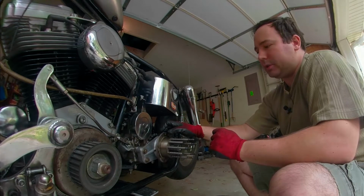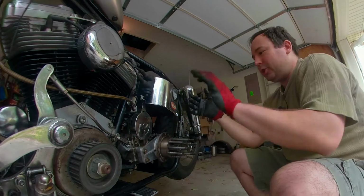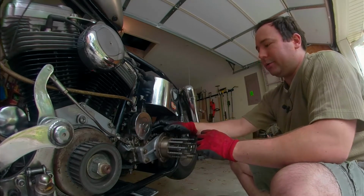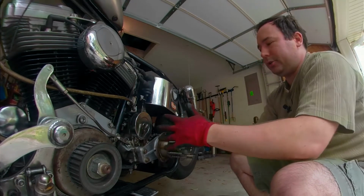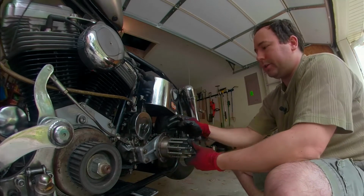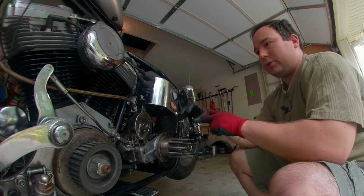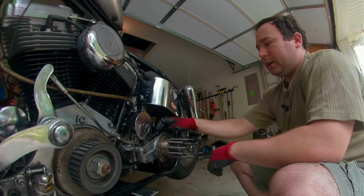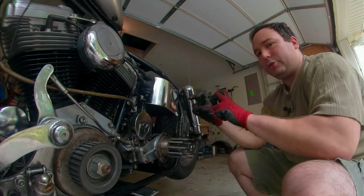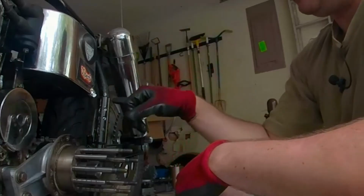But I thought maybe there's this plate that I've installed, this support bracket. You see, when it's moving the chain with really high torque, it doesn't want to shake the heck out of the main shaft and destroy the inner bearing. So you have an outer bearing that usually lives in the inner primary. This thing's got a bearing that press fits on there, and I thought maybe this plate is pressing against either one of the two shafts. There's two shafts, one inside of the other, or it's against the nut here. You see, when I bought this, it said it can't work with a super nut, which is something a little bit thicker to prevent the oil leak, which is how all this mess started anyway.